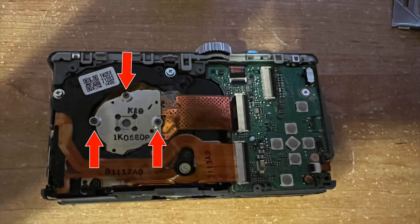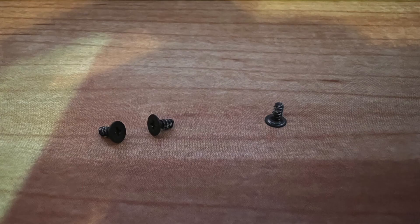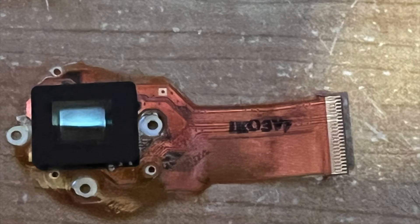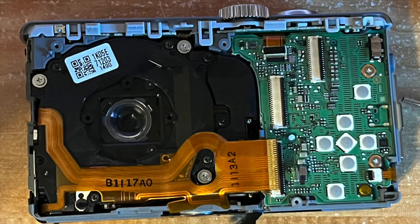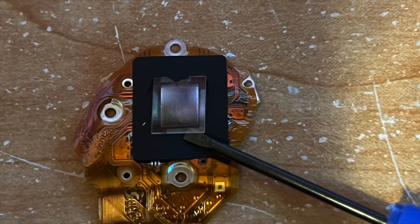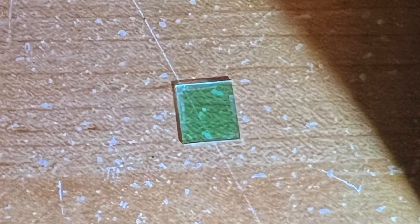Here's the meat of the situation. Now we have to remove the three screws that hide the sensor. Here's a picture of the sensor taken off with the ribbon cable — again with the little black slip-on connector that releases it. We use a tiny screwdriver to pry off the infrared cover. That's what the sensor looks like with the cover off. This is the infrared blocking filter.